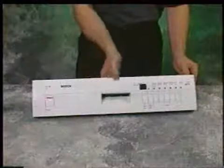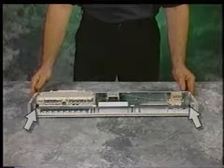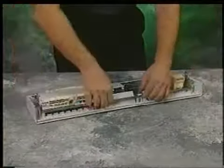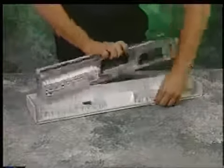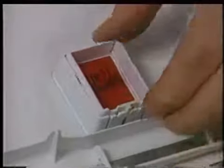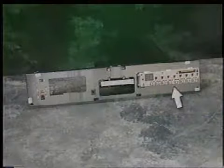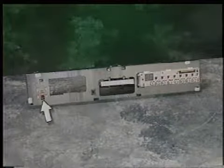Now that the console has been removed from the unit, it can be separated into two assemblies. First remove the two retaining clips, located one in each corner. Now undo the two outer and two inner console locking tabs, then separate the console frame from the console. The console face has an on-off button, which can be removed by pressing down on the two retaining tabs and then sliding the button up and out. The selector buttons are removed by lifting them up and then off their mounting pivot. The console frame houses three components: the control unit, door latch mechanism, and on-off switch.